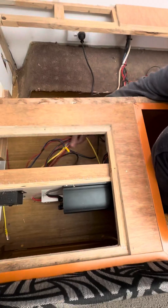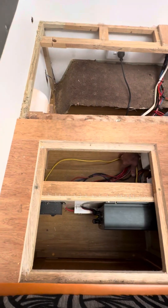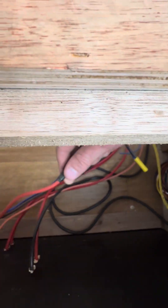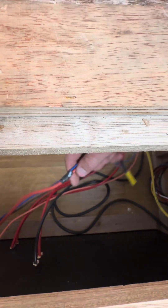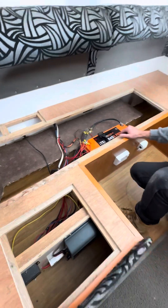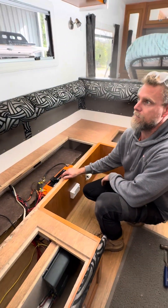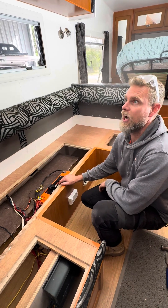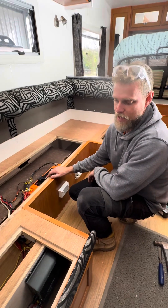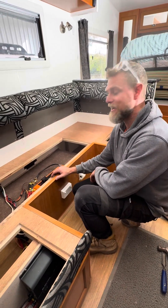Mechanical protection on all the cabling is just non-existent — cables are just run along the floor, not protected at all. The best they've got is a couple of bits of tape to strap things together; no cable ties, nothing. Highlighting these issues will hopefully help people understand what not to do when it comes time to replace their batteries.